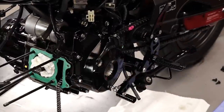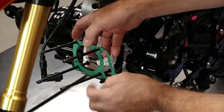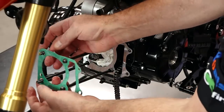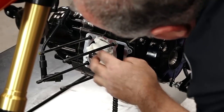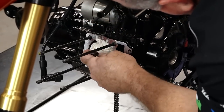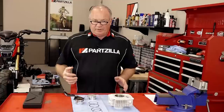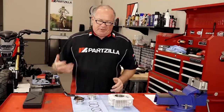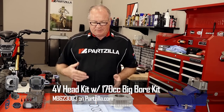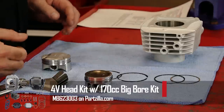Last, let's go ahead and get this base gasket off — see if it's going to make it easy for me. You can tell this engine's brand new. Honda gaskets never come off that clean, ever. So we've got it prepped as far as we can take it right now. Before we go any further, we need to check the ring gap. The way we're going to do that is we're actually going to use some guidelines set forth by Wiseco because this is a forged piston and that is what Wiseco specializes in.